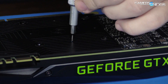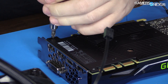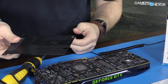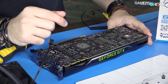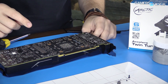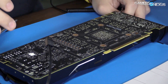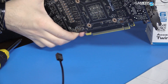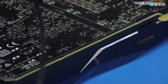The second half of the backplate is really just a cheap backplate — more for aesthetics than anything else, with some structural support from all those screws. The tiny screws break easily when reassembling if you're not careful. The expansion slot cover is still mounted. The heat sink, which uses a vapor chamber on this card, has been loosened. There's a blower fan here, and now we need to get into the underside of the shroud.